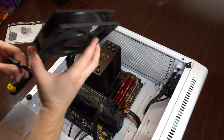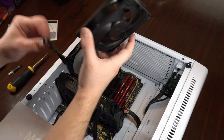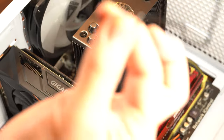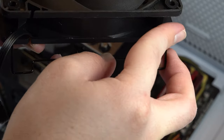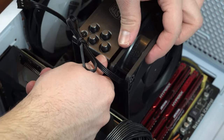So now you have the heat sink on there. Take the fan and tie up the cable a little bit so it's not cables everywhere — cable management is always good. Look around the fan and you'll see little arrows; the arrow points towards the CPU cooler. Take the little braces that came with it, hook them into the little holes, and hold them in place. Put the fan on the side where it needs to go, pull the bracket back, and hook it into the little groove. Make sure both sides of the bracket are in because it's easy for one to come out. Now the fan is nice and snug.